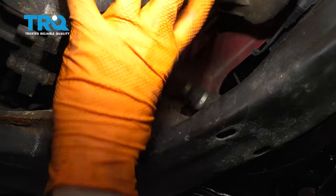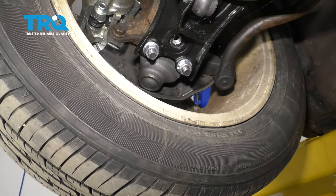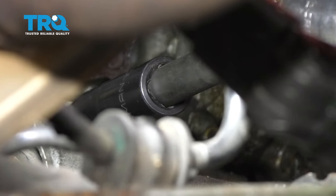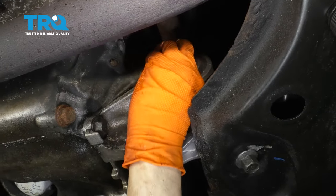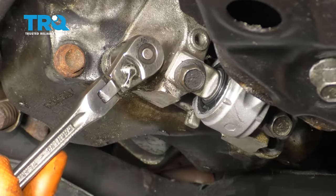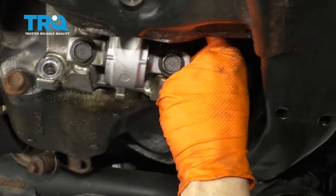I'm just going to leave the axle shaft up there. The transmission is coming down right here, so if I pull it down it's just going to be in my way later. Do the same thing for the passenger side — the bolt and the two nuts. Take out this 14mm bolt here. There's going to be another one on the other side of this mount for the carrier bearing. Now take off this 17mm bolt, and I'm actually going to take this whole bracket off just because that'll release the bracket for the carrier bearing — so more 17mm bolts. Remember that this one's shorter than the upper one, so try to keep these in their corresponding location, and there's one more right up there that I'll have to remove as well.